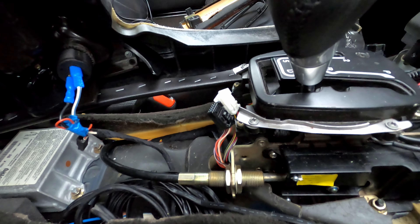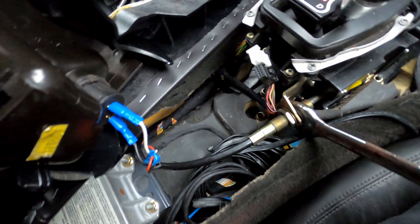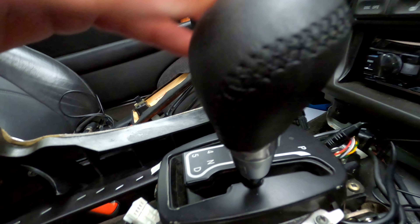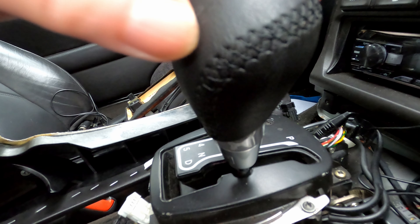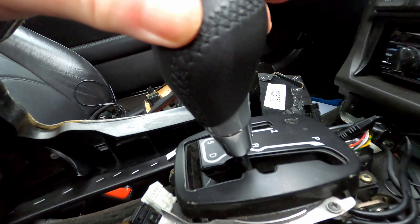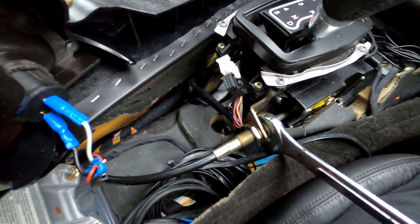So that's maybe a little bit less play than before. It's dead in the centre of the neutral notch. Press back, it goes forwards — perfectly in place. All I'm going to do now is get a spanner on each side of this and just nip them both up, and job's done. Then I'm going to do the reverse process putting it back in.